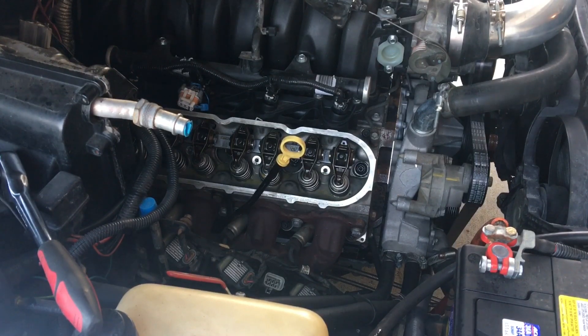It's the simplest way to verify 100% what length push rod you need and to know 100% what your preload is once you tighten that bolt down. Once you tighten that rocker arm bolt down, you get your lifter preload by adding together the base distance — zero clearance between the rocker arm push rod cup and the lifter without compressing that plunger. You guys have to be super careful when measuring that base distance, because just your fingertips on a bolt can start to compress a hydraulic lifter plunger.